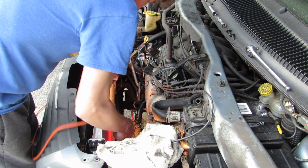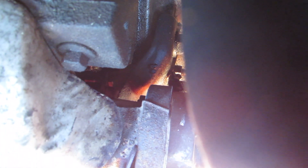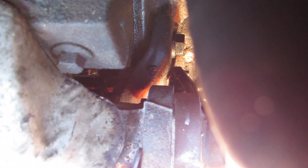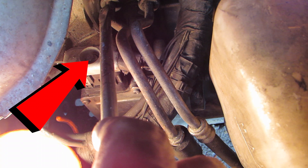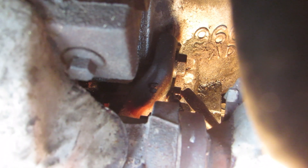At this point I'm still looking for the issue on this car and getting ready to drop the starter. Here's the ground bolt right here — this one is the hardest one to get to, and that's why we had to move things out of the way like the fan, the radiator hose, and other stuff too. We also have to move that cap right there because the exhaust is in the way and those lines block wrench access to that bolt. That cap is just one 8mm bolt going through it, so just loosen that bolt and pull it right out.